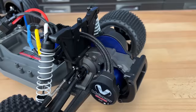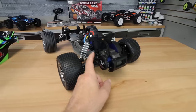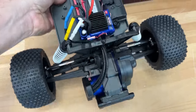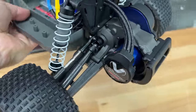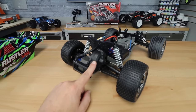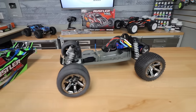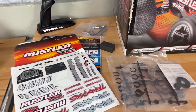Now let's concentrate on the big change: this is the 272R transmission. We've got an updated differential in here which is oil filled, so it's got a much smoother differential action. It's got a lighter oil in it than the drag transmission. You could swap out whatever oils you want in the gear differential, so if you want to tune this, you finally have that option. There are all metal gears on the inside, and there are two pinion gears — one for standard running, and over in the pile of stuff that comes with the truck is a high speed pinion. That's another reason people love the Traxxas Rustler VXL: you can hit some really high speeds.